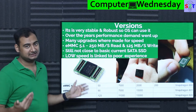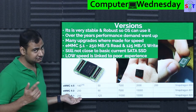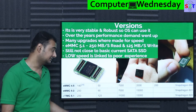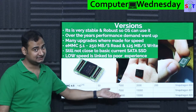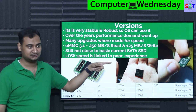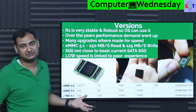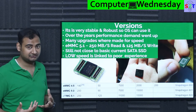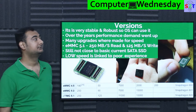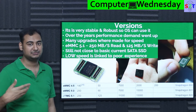Even EMMC 5.1 only offers 250 MB/s read and 125 MB/s write — at this point even a GoPro can exceed that limitation. Random IO performance is okay but not great. So low speed became linked with poor experience: if you had a cheap phone with EMMC, you had poor experience because even though the operating system, RAM, and CPU are fast, your speed is always limited by the slowest component — and that slowest component was EMMC. That's why even with all these version updates, it never shook its image of being a cheaper, inferior alternative.